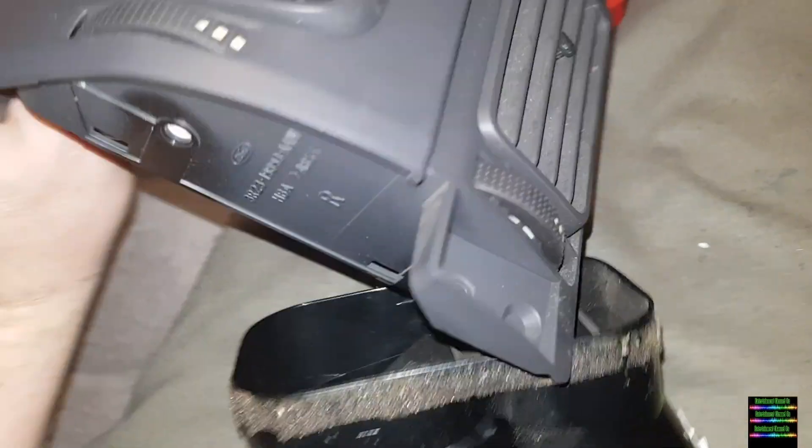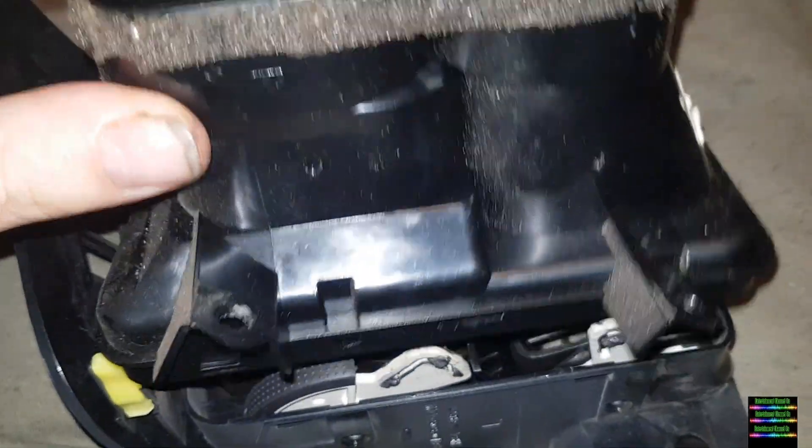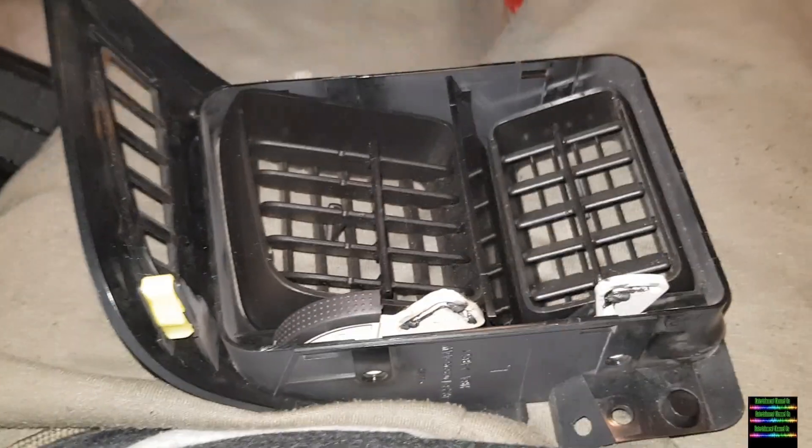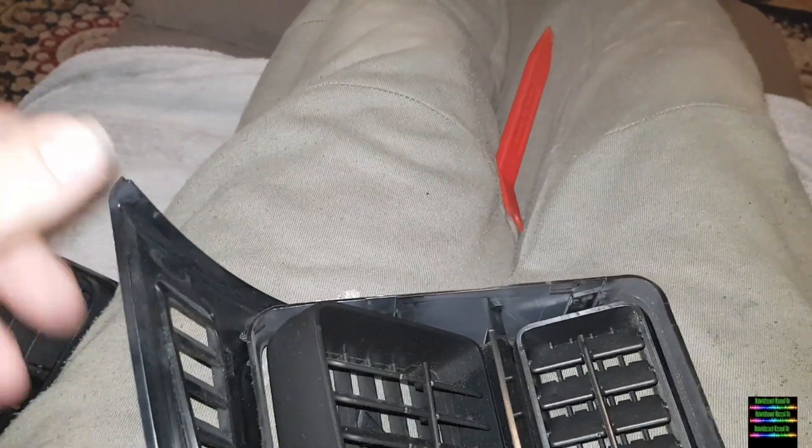So these are the dual vents for the BF - I've got to paint the fronts. To get the back parts off them, they've got these little lugs - see that little lug down the bottom, and another one under there, that square little lump. They're very easy. There's that little square - on the adjacent side, you just pull up on the edge and these back areas will slide off, very easy.